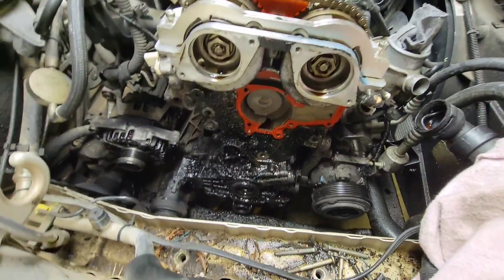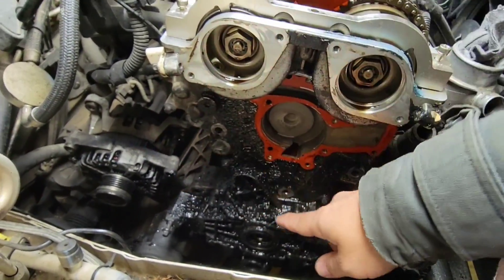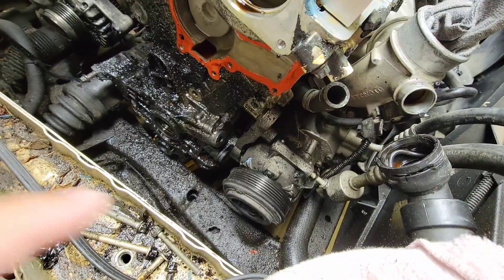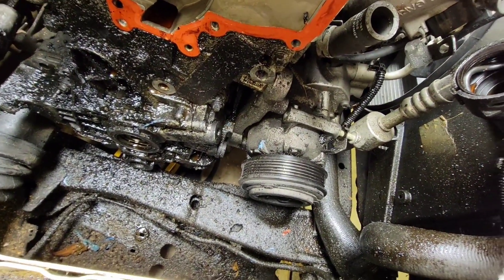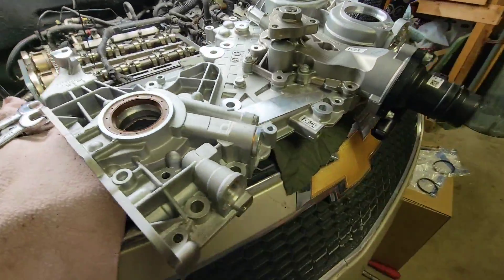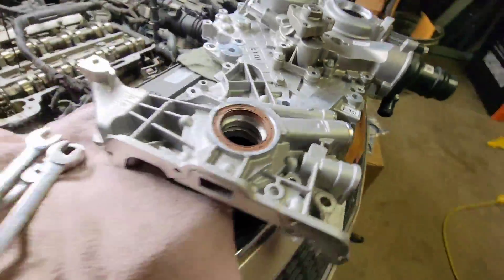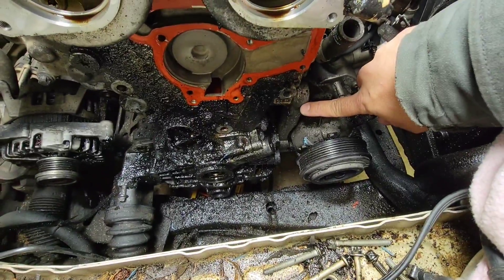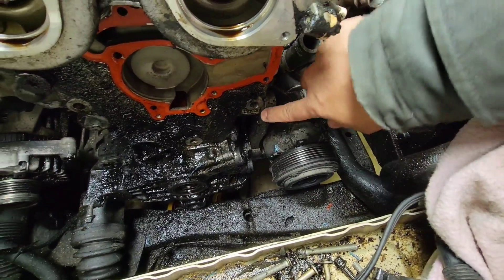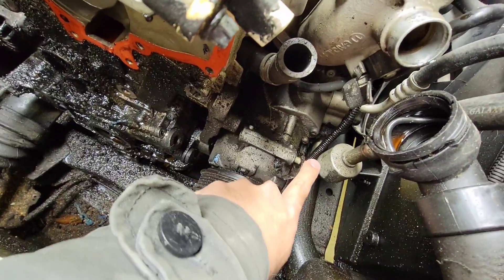So right there is the old one. What I did earlier - I took the alternator off, there's bolts down here and one up there, just two bolts. Then this AC pump is what I'm working on right now. Taking out this AC pump is a bit tricky because the bracket to the AC pump is bolted to the timing cover. This hole right there - bolts go in there for the AC bracket bolted to the timing cover.